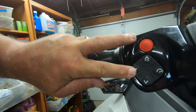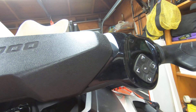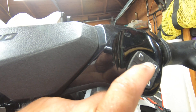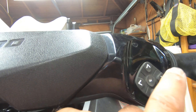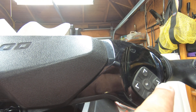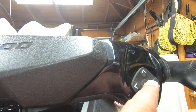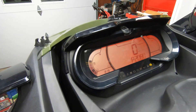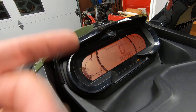A lot of times on the web you see that you're supposed to press a set button, or a set and mode button combination. On the FishPro it has a mode button, but there's no set button — there's an OK button. If you read the instructions for checking fault codes on a Rotax engine, it says press the set button, so you might think to press OK, but that isn't the way to do it. You press the right arrow button to access the settings, then press OK, and it will show you the various settings. You hit codes, hit OK, and it will show you the active fault code. Apparently if there are other fault codes, it'll scroll through a list, but luckily I only had that one fault code. I'm going to go ahead and connect up the hose clamp and hopefully that'll take care of the problem.